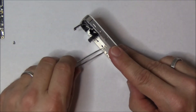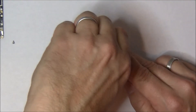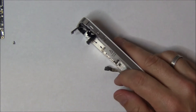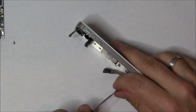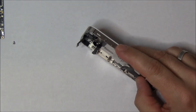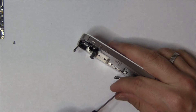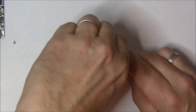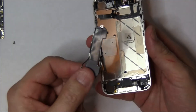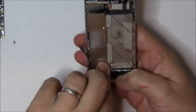If you see any gapping after you assemble it, take it apart and redo it, because if you have that gapping there, the first time you push down on the screen or put it in your back pocket, you will break the screen. Now we're going to put in the speaker and antenna pickup assembly, which goes on top of the dock port.